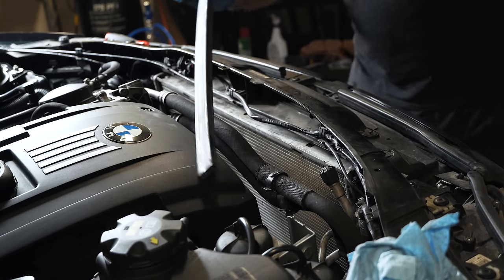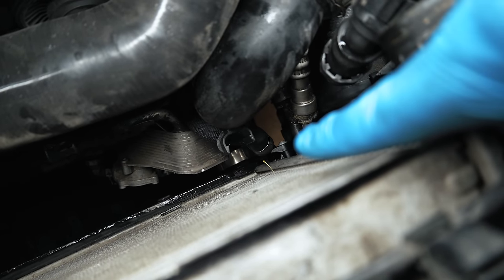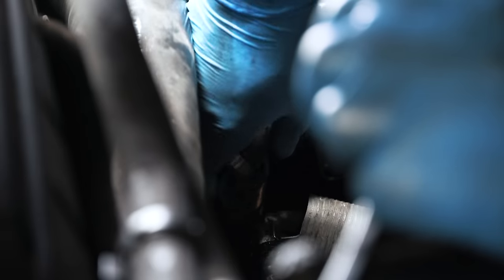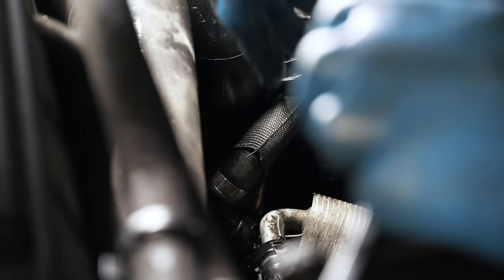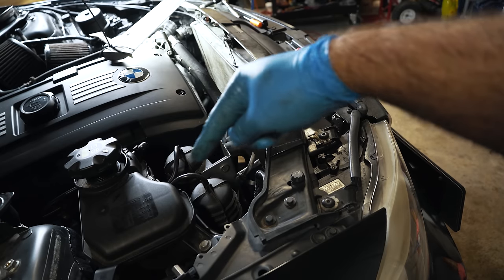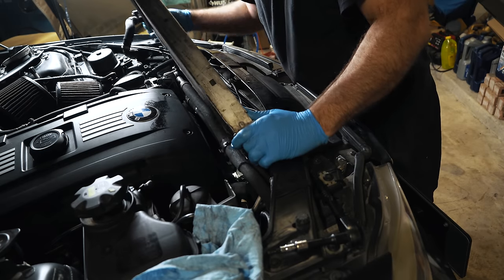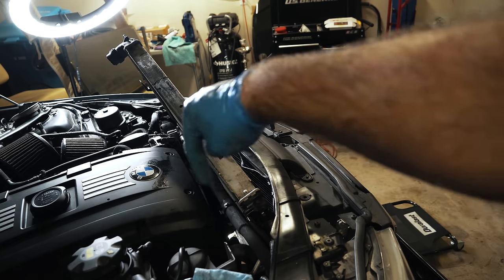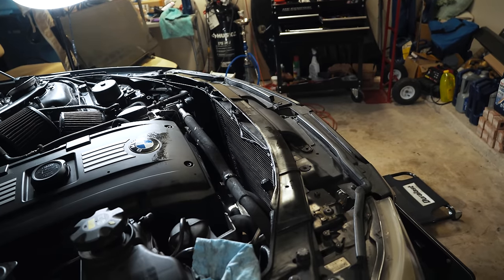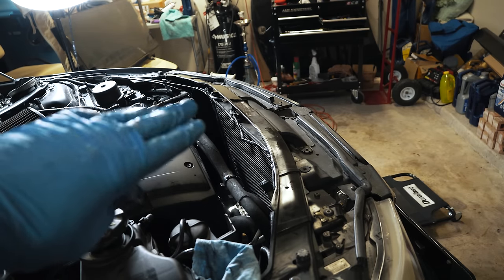There's a rubber strip at the top of the radiator — you might as well remove that now. There's your transmission cooler. There's a screw on the front of it that you have to remove, and there's a Torx screw there as well. What I did for this side is I unplugged the coolant line from the radiator off the transmission cooler — I just undid the clip. That made it possible to get that out without unscrewing on that side. On the other side, the line goes somewhere over there so it's too hard to get to the clip, so I'll try to raise up on the rad in such a way that I can unscrew that hose easily. At that angle I was able to get that side out. Admittedly, that wasn't the most elegant removal of the radiator — I had to tug quite hard — but really it's just the plastic body getting caught up with some metal lines and some heavy-duty plastic. So you're not harming anything by yanking on that side, and it saved me from pulling out any intercooler piping.